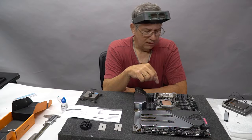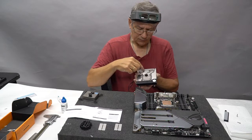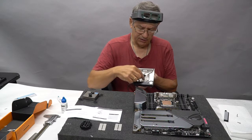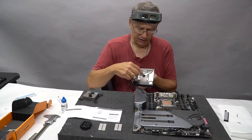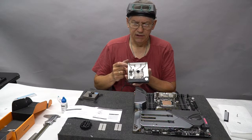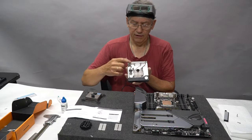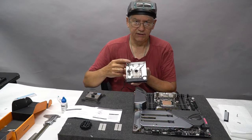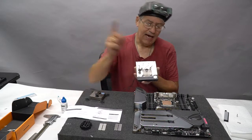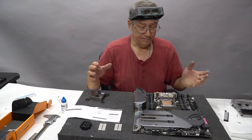And that's another thing about this relative to a monoblock. The monoblock has direction in that the water comes here. It circulates over the VRM and it's supposed to exit here, but it is still connected to the CPU water loop. So this water can circulate around and get warmer. It has been noted that when using the monoblocks, the CPU temperatures can be a couple of 3 degrees centigrade higher than when using this. And the idea is, well, you're getting active VRM cooling, so that's okay. I want it all. So what I want is the very best cooling on my CPU and the active VRM cooling. And basically I'm isolating them this way. So that's where we're going to go with this.